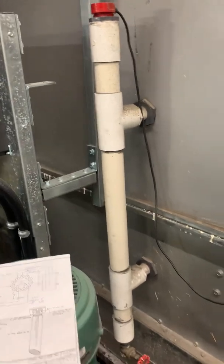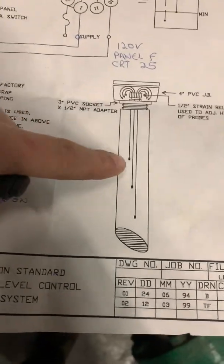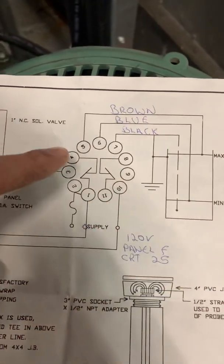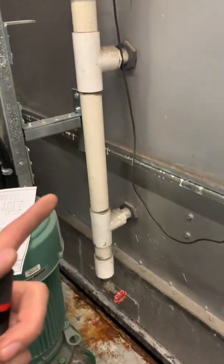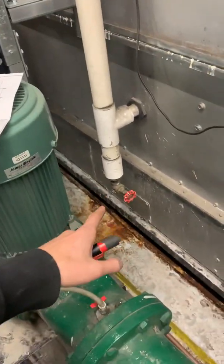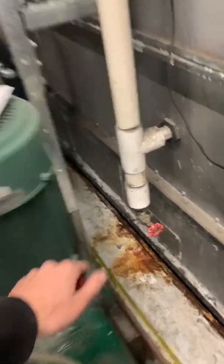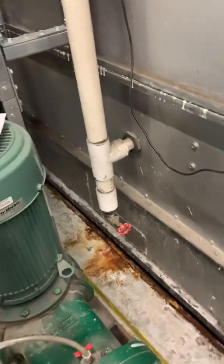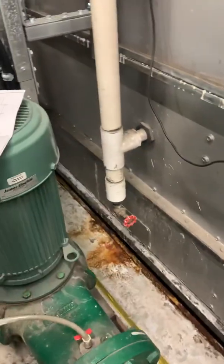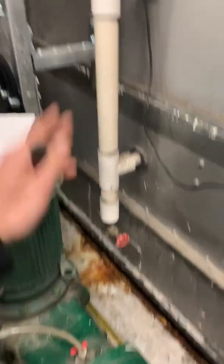Second, I wanted to check the conductivity sensor to see how it was doing, so I pulled it out and cleaned it. You have the max fill probe, low fill probe, and ground rod — the max is the brown wire. When I went to put the sensor back in after cleaning it, it would only get to about partway in and I couldn't push it any farther. It felt like something was stuck in there, so I cracked the valve and no water came out — obviously a plug. I got a piece of ready rod and broke all the dirt out, and it was just pure mud. This chamber was completely blocked. With no water able to travel through there, when the tank fills, the water level won't come up in the sensor chamber — no wonder it was also running forever. I broke it free, got all the mud out, cleaned the sensor, and put it back in.